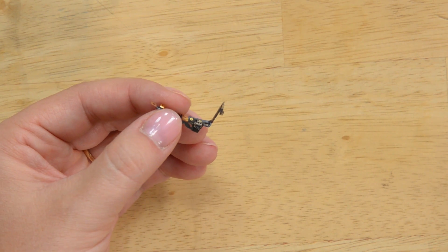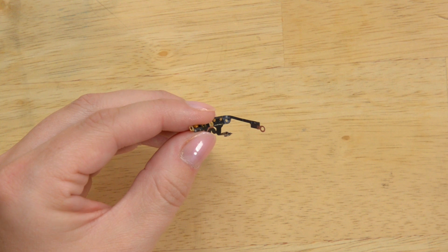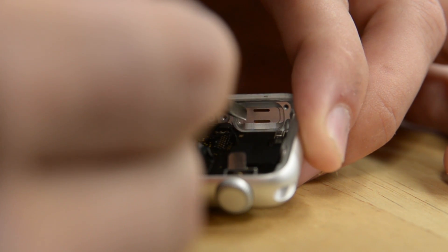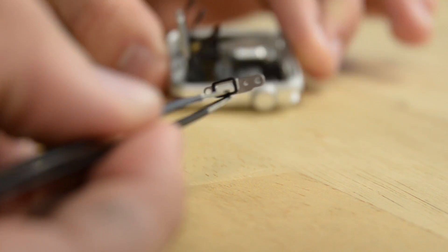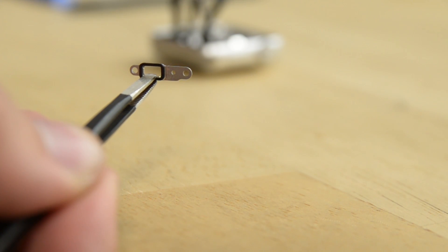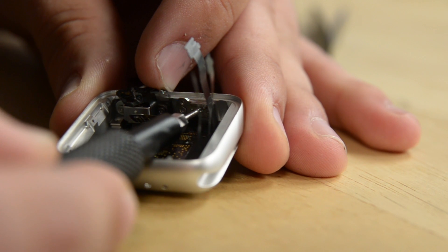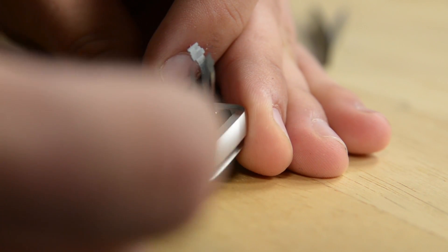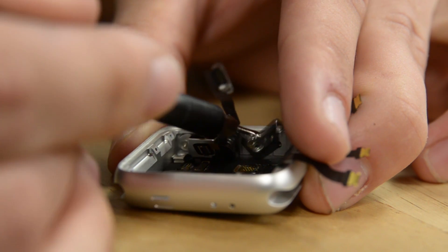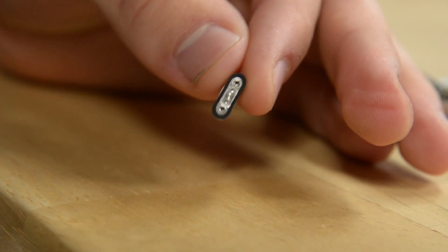This is the antenna, and it's got the new GPS. The old one only did Wi-Fi and Bluetooth, but this one incorporates GPS location in the one and only antenna. Here's the microphone bracket — another example of how they made this watch waterproof, with an o-ring here designed to protect against water ingress, keeping the watch water resistant up to 50 meters. Next I'm taking out the two screws holding the side button and internal side button bracket, which exposes the side button showing the same o-ring they had in the Series 1.